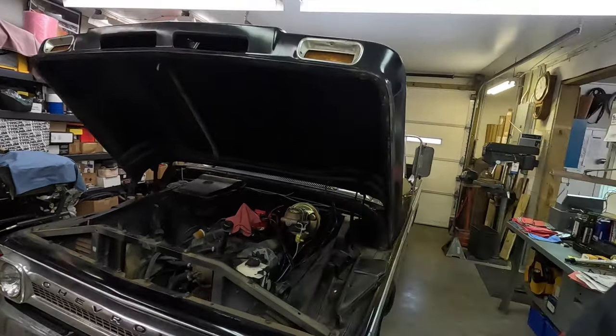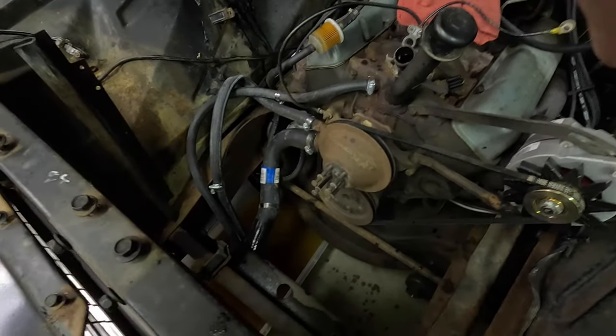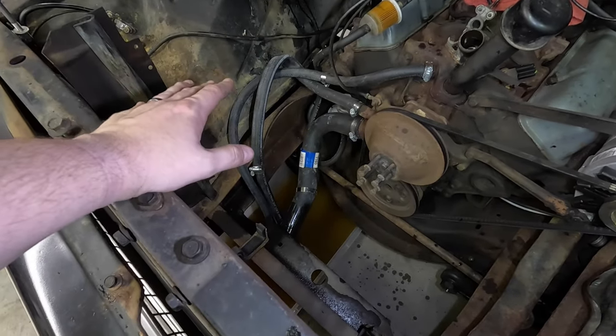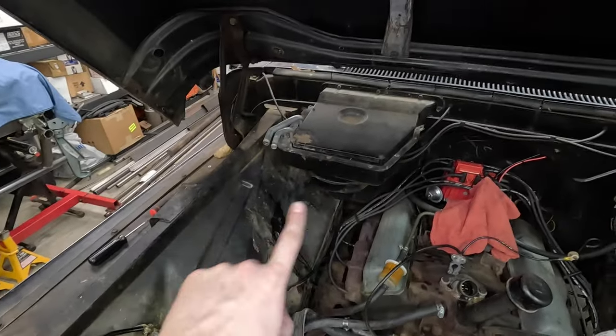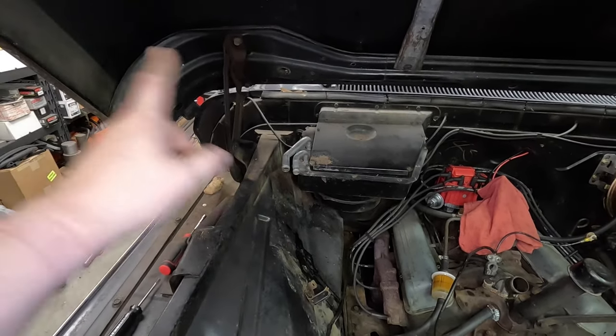Two of the things we're going to be doing to this truck are putting a vintage air kit on it and putting power steering on it. It is a three-on-the-tree with no power steering. As long as you're going down the road it's really no problem, but as soon as you get into a parking lot it becomes a handful. Just getting this thing pulled in last night was a bit of a hassle — you really have to lean on that wheel to get it to turn. We've already got a pan, dropped the radiator hose, and got the antifreeze drained out, because the vintage air install requires pulling out this old heater box. We rebuilt this heater box while it was here so he could drive it over the winter while we waited on the vintage air kit.